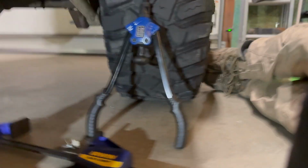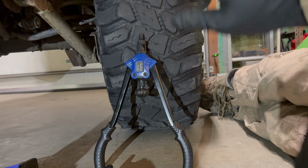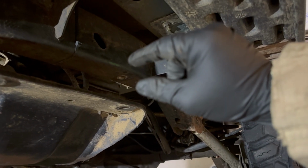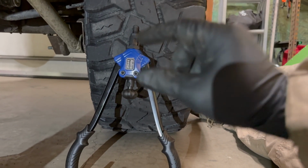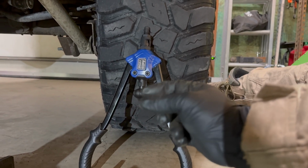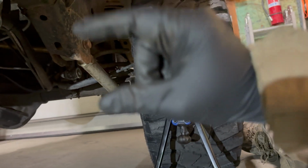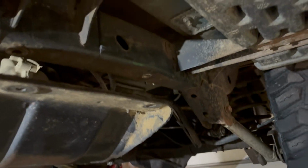So again, unless you're Bubba, I would recommend you use those quick grips, and you pinch it together and you adjust, you screw it in as this nut collapses in there. The space that needs to travel is less, but you have more play now in this. So you have to open the arms up and screw that middle part in there so you can get another go at it to continue to crush that RivNut, which crushes it and spreads it out, kind of mushrooms it up in there so it gets stuck. So yeah, anyways, just use that quick grip.